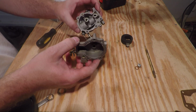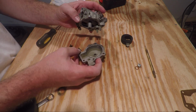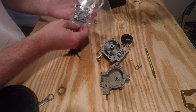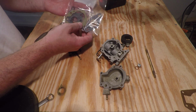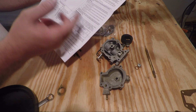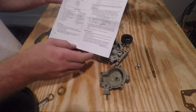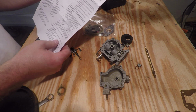Once you've cleaned the two bodies of the carburetor, the upper and the lower body, sufficiently, and are ready to reassemble the carburetor with your rebuild kit, you can open up your rebuild kit. You can find all of your gaskets, and you've got a new needle, a new brass fitting. You also have this Johnson Evinrude carburetor instruction sheet. I'll try to scan this and leave a link in the description below to this disassembly, cleaning, and reassembly procedure, so you can print that out as well.